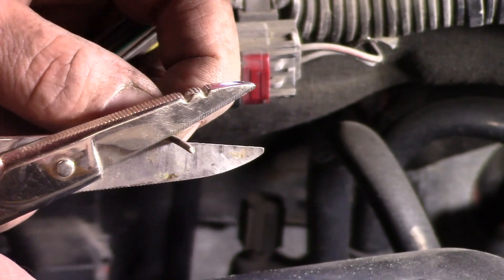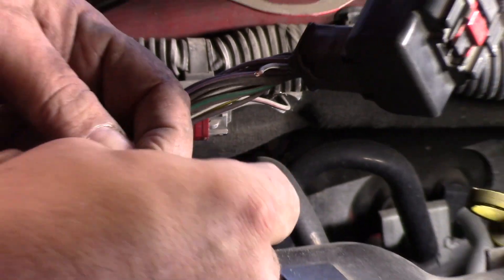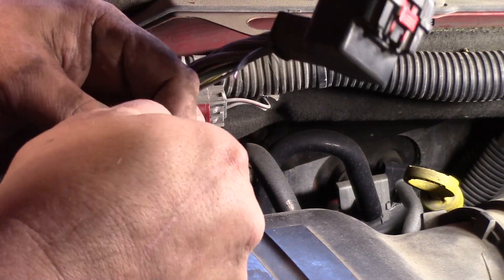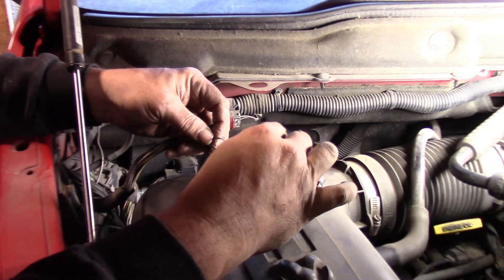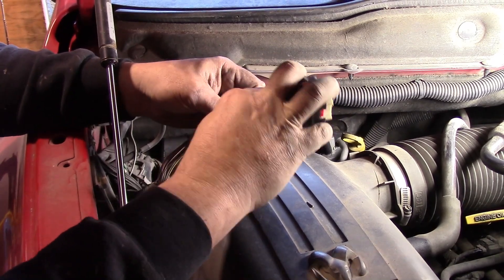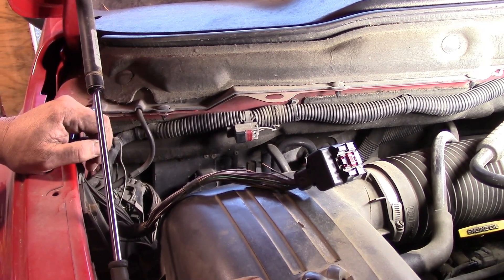But I, like Alton Brown, do not like uni-taskers. And a pair of wire strippers are pretty much just a uni-tasker — they don't do nothing else. However, these little bad boys, which are called lineman scissors — my day job, what I do for a real living. Unfortunately, I don't make enough to make a good living off of YouTube yet, so I work in the field of information technology. Now, what we're going to do is splice in a little section of wire here. We don't want to just pull this because then we're going to put everything in a bind right there. So we're just going to make a little section of wire, fix that, solder it, then put some heat shrink on it, and crank this truck up.